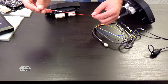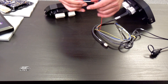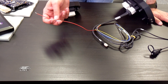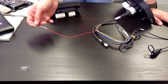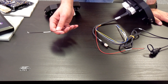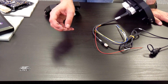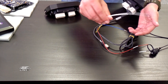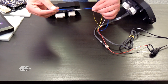Power is red — this is going to be switched 12 volts. The only tricky thing is you want a clean switched 12-volt source, so you're not going to want to tap into something like your fuel pump relay with 20 amps of noisy fuel pump on it. You want something low noise, low amperage, switched 12 volts. Black is going to be your ground — ideally go back to the battery. Do not ground it to the screw on your plastic dashboard or plastic shifter housing or you'll end up back at square one. CAN high is white, like clouds, high in the sky. CAN low is blue, like the ocean, because you can't go lower unless you go underwater.